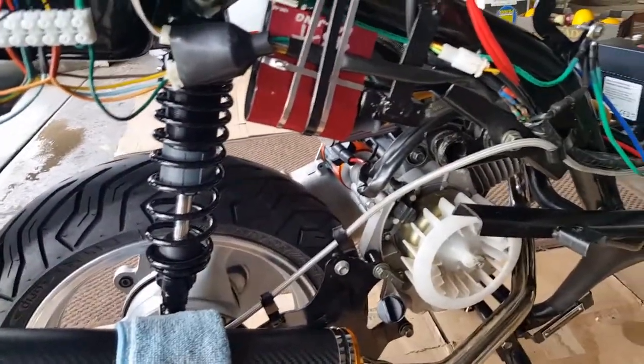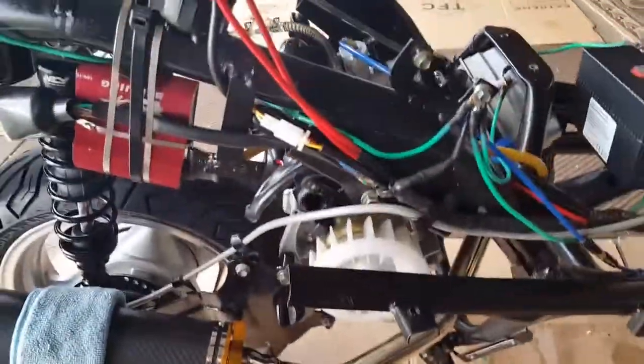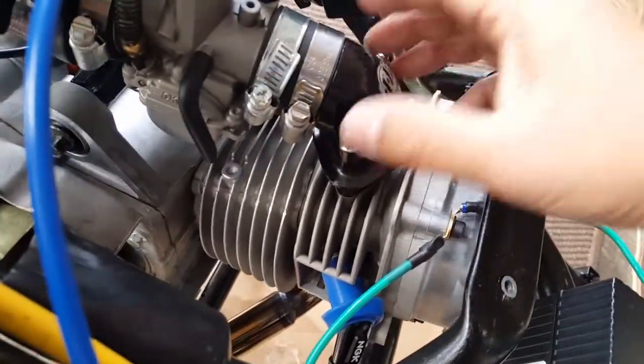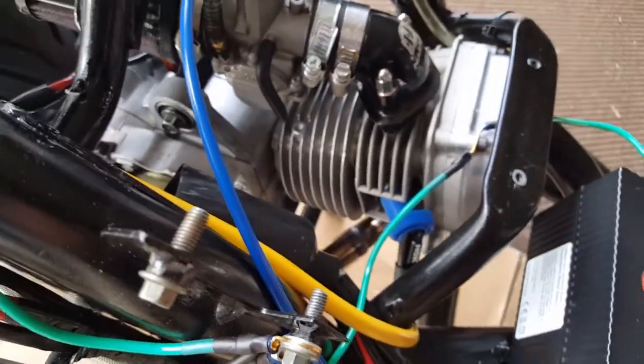Okay, we're gonna go ahead and save that for maybe a drier weather day. That way we can sand it down and give it a good spray coat. But for right now, let's go ahead and configure our oil cooler. But before we even get to the oil cooler, we gotta install our fan shroud back. We might be able to just take the studs off here. Hopefully the intake studs come off with it. But if it doesn't, then we definitely have to reassemble everything all over again. So it's no big deal.